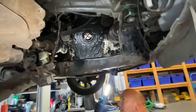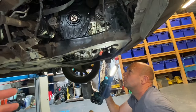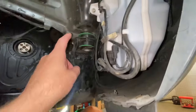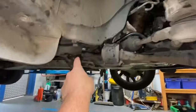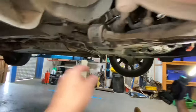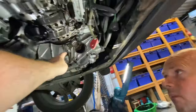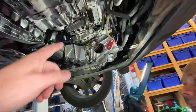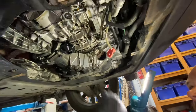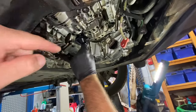That was quite hard work. We've established that the sump actually doesn't come out without removing the subframe. I removed that bolt just to give us a couple of inches and dropped the back one down as well to give us quite a gap, but it was still very tight. We've got the sump off. Chris said that back dowel is what it was hooked on - which is quite big. And it has got a baffle over the crank, but you can see little bits hanging out at the oil pickup there.